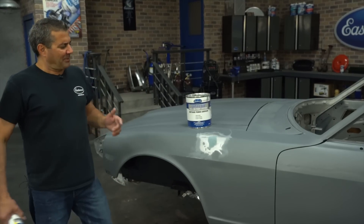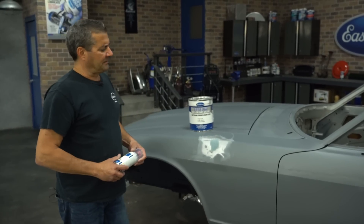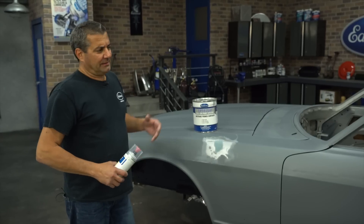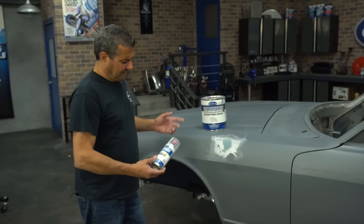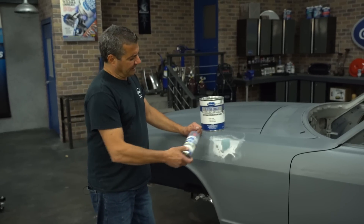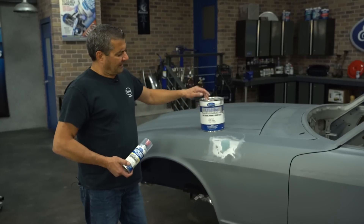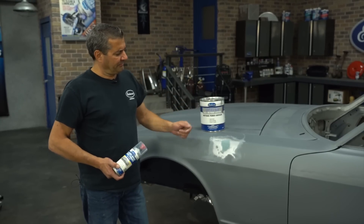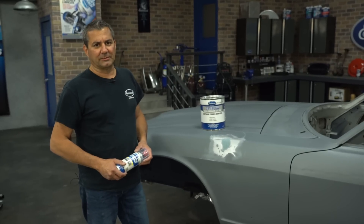We finished our repair, but we're back down to bare metal. Earlier we sprayed the entire car with the epoxy outside with the gun. We're inside now — we can't go outside because of the rain. So here are our other options: 2K air spray epoxy primer — we can hit that spot there — or we can use our Optiflow roll-on system. I'm going to choose this one. We don't have to mask anything off; it'll give us a nice epoxy finish, and we'll be able to go ahead and do the rest of the bodywork.